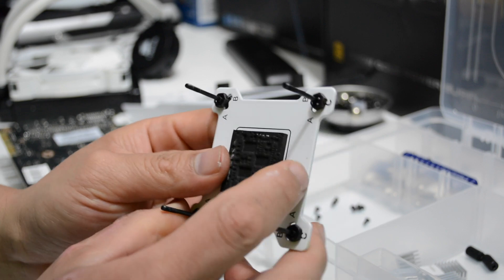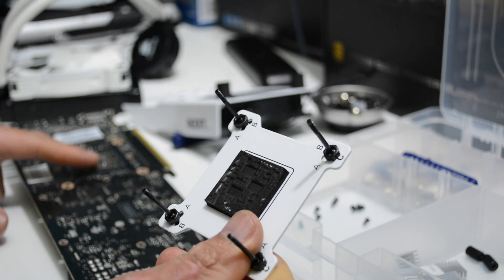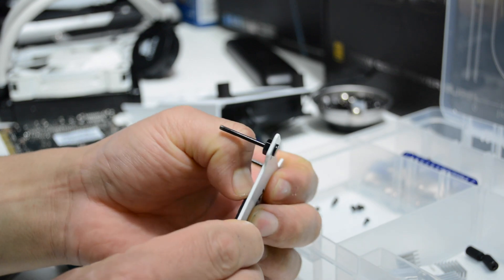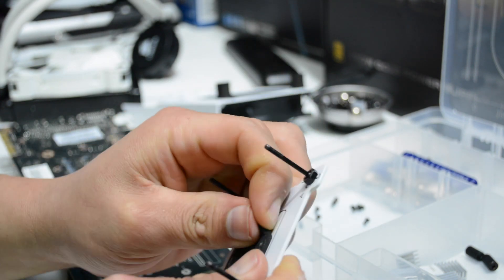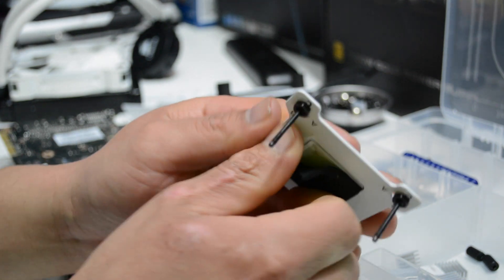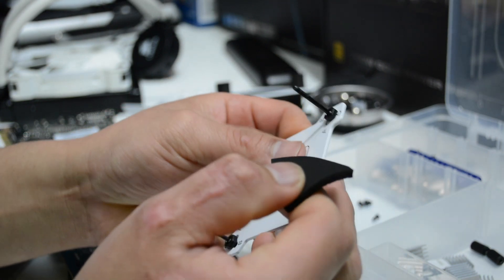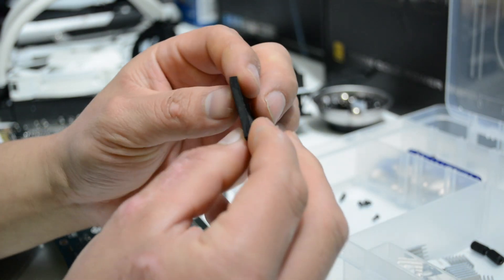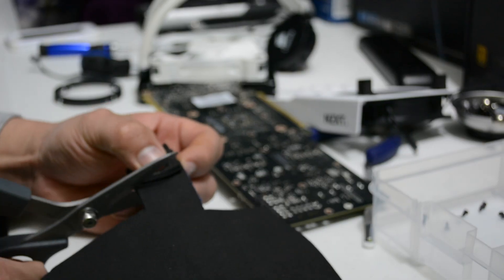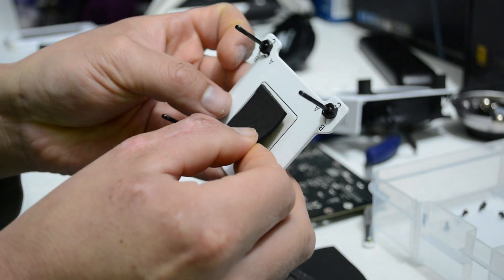What I'm doing right now: this black foam part is too thick and I had a problem with it the last time I installed the Kraken G10 on my GTX 780 Ti. I tried cutting it and almost sliced my finger. So I decided to remove it and instead cut a small piece from a mouse pad I had laying around — and ta-da! It's ready to go.